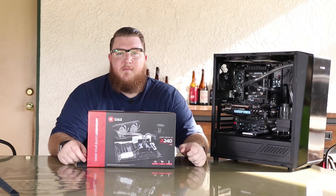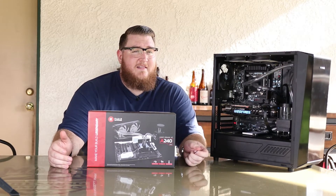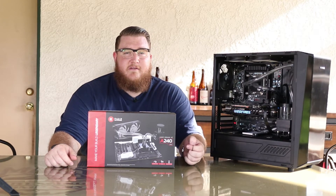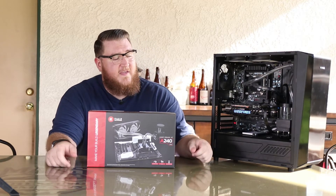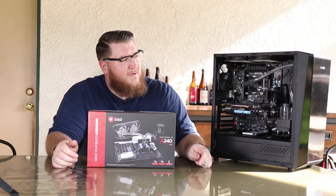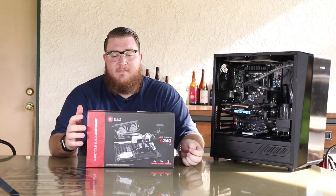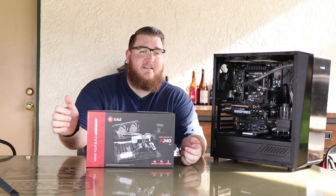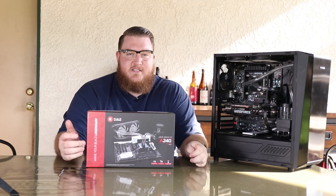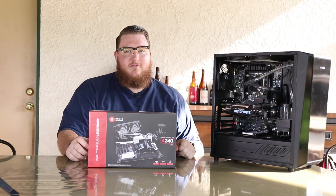We've got the Fluid Gaming Kit installed on the computer. You can see down here by the debugger screen it's at 49 degrees Celsius, which might not sound great, but it's about 90 degrees outside with a lot of humidity, so that's pretty good. When he takes it home and plugs it in, he'll see a lot lower temps. The install went fairly nice — it comes with everything you need to get going. We did have some issues with mounting the pump, but nothing out of the normal. The biggest thing is to make sure everything will fit in your case. EK does a good job on their website specking out different chassis, and everything did fit, but there was no real way to mount the pump so we had to improvise. It's in there firmly and it's not going anywhere. Thanks everybody, this is Chris — if you liked the video give it a thumbs up, like and subscribe. Have a good day.